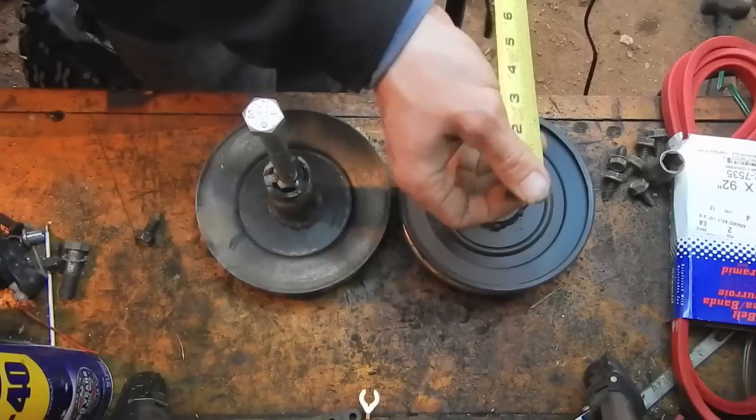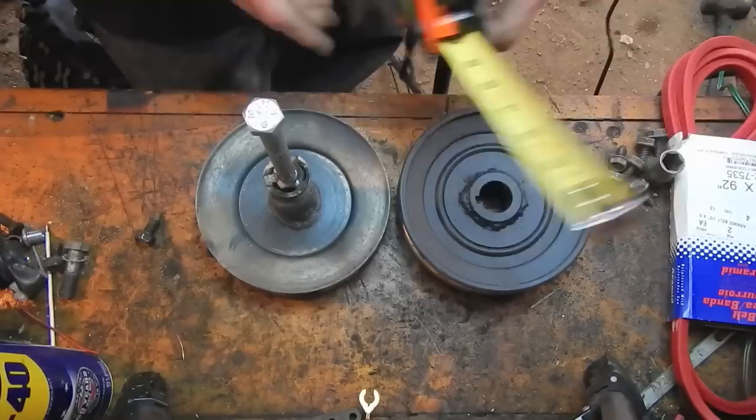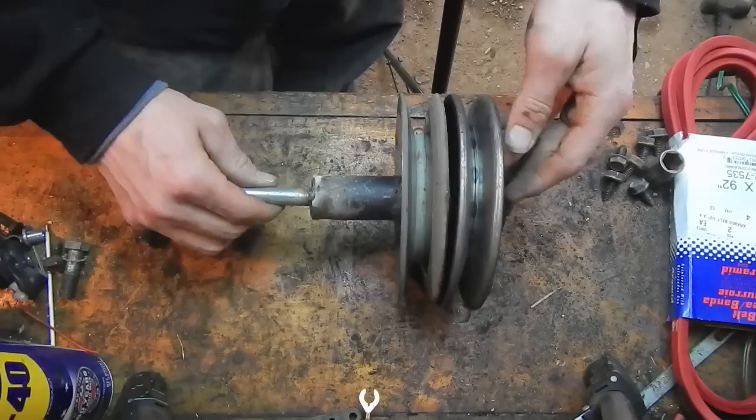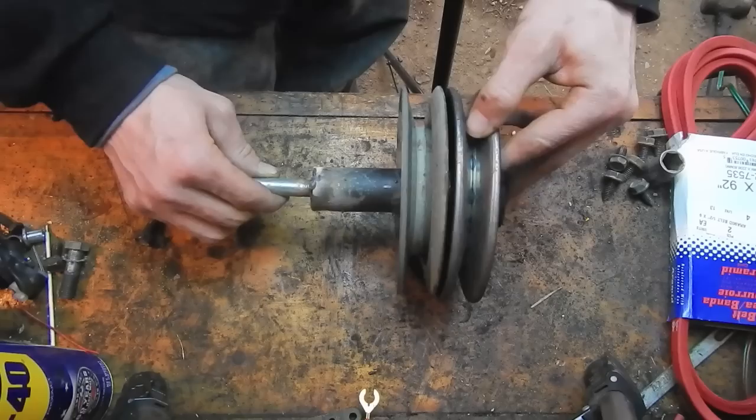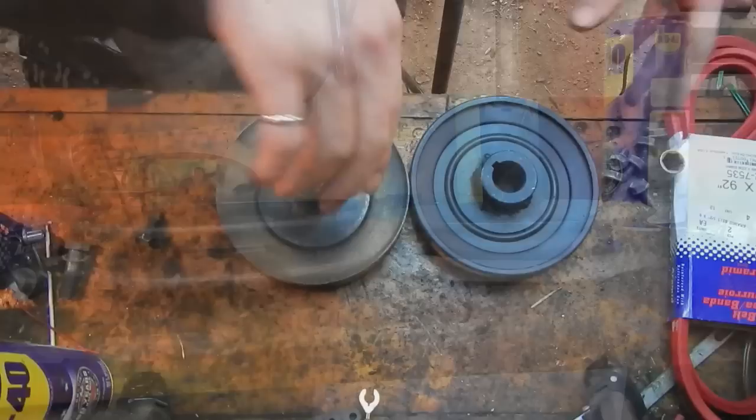As you can plainly see, they look like they're exactly the same size — and you'd be 100% correct. That is a six inch pulley and this is a six inch pulley. But there's a significant difference in the inner diameter of these pulleys. This one has a deep well, this one does not. Upon measuring, this one is actually three and a half inches inside diameter and this one is actually four and a half inches inside diameter. So that's a whole inch larger, which should make a fairly significant difference even though both pulleys are essentially the same outside diameter.